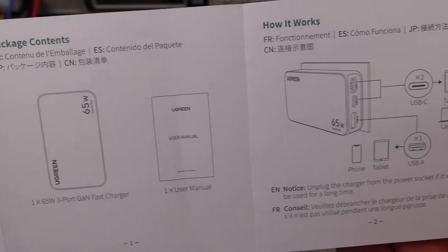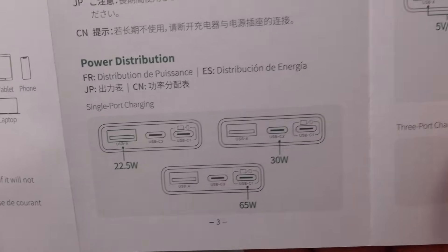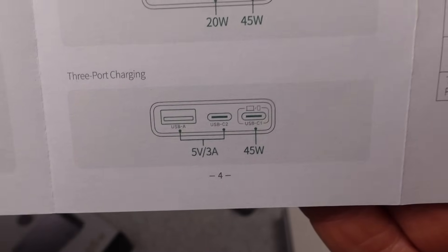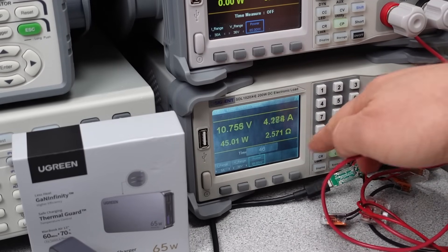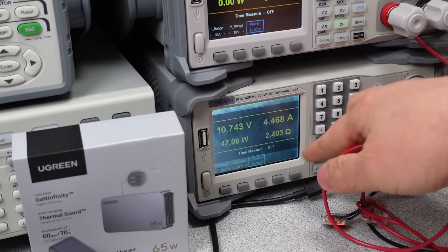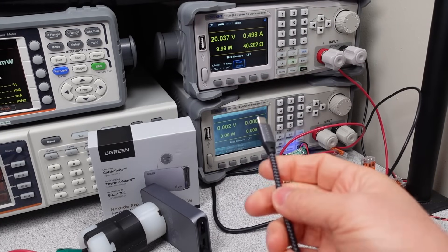This has three ports — two USB-C ports and one USB-A port. The user manual gives infographics to figure out what it's going to do and whether it will work for your needs. There is a higher-power primary USB port that will prioritize 45W with more than one device plugged in. This port does offer 11V PPS (programmable power supply mode), but it trips on overload at 4.5A, so it won't do the 5A level. The power negotiation on this device was fast — better than most others — and it keeps ports on as long as you aren't overloading them.